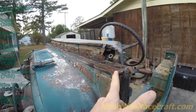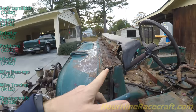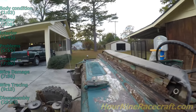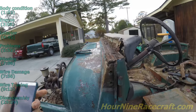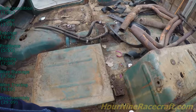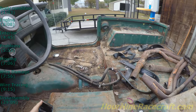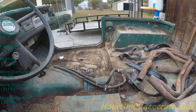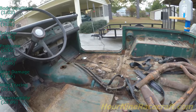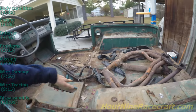Getting the door hinges off — I think we broke off one on each side, both at the same location: the low one on this corner and the same on the front. You can see there's a considerable amount of rust where the bolts broke. My dad's got a little welder in his shop, so he's going to bend up some steel, shape it like it's supposed to be, patch a lot of these, grind out the big rust spots, and weld another little panel in place and sand it down.